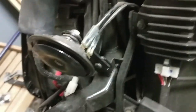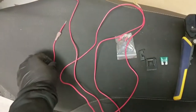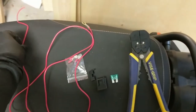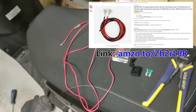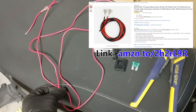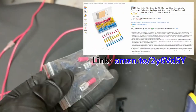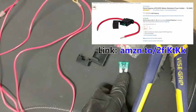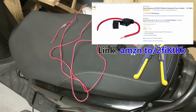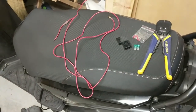For the parts, to run power from the battery to the horn itself, you essentially just need a long wire — I think I had this laying around, it's probably 16 gauge. You'll need a connector piece that hooks up to the battery and a couple of automotive electrical pins, which you can get super cheap at Harbor Freight or AutoZone. I also have an old inline fuse connector I'm going to use for extra protection — if water gets in there, the fuse will go off before any damage is done to the battery.